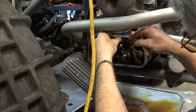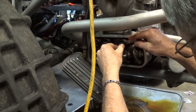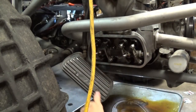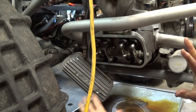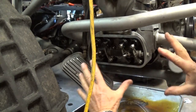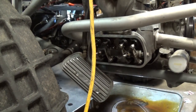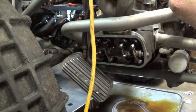Perfect — you don't want them too loose. This is 6 thousandths. I have not adjusted these things since I assembled this engine. I only took it apart to put these two new O-rings on and check it out, because sometimes when you replace stuff, things settle in and it takes some time to move around.